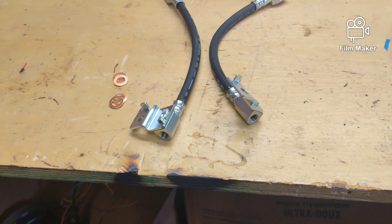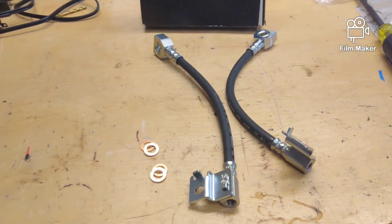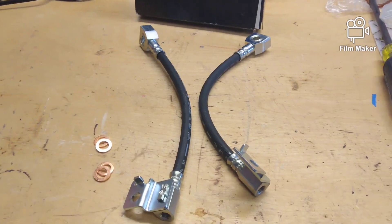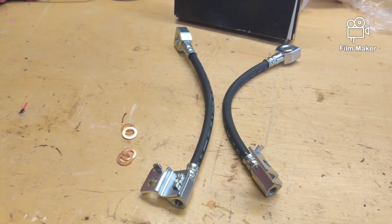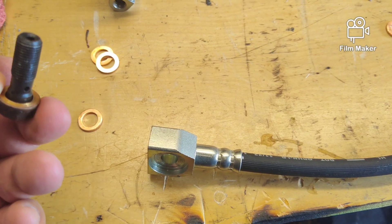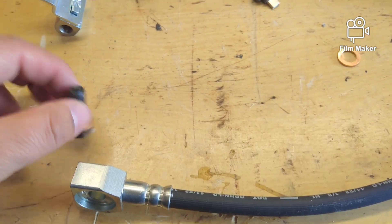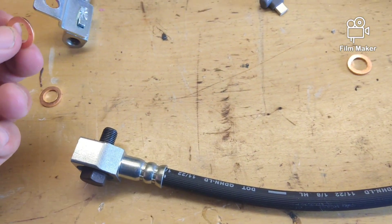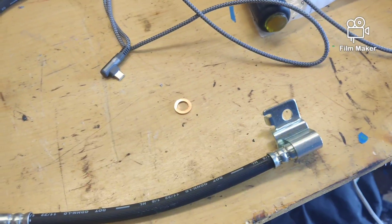With the Explorer rear axle, it doesn't have a vent tube that locates the Cherokee brake line, so once I get this done I'm gonna have to take it over to my buddy Tim Underwood or to Gabriel Miller and see if they can weld a bolt to the axle to locate that center brake line. Let's get these on the Jeep and start on the hard lines. Here we have our banjo bolt — I'm going to take this and a copper washer, stick it in here, then take a secondary copper washer and put it on the inside.